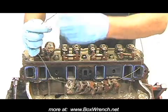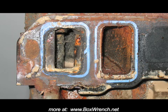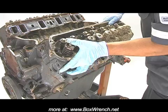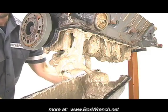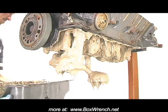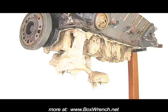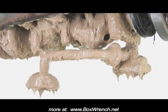As we're going through all these pieces pulling things off, we're looking at gaskets, looking for cracks, looking for easy-to-spot damage — everything's fine. There are no signs of gaskets leaking water through the water jacket into the oil areas of the engine. We just keep digging deeper. When we pull the oil pan off, the whole oil pickup tube was covered — every space inside the crankcase — and the water just kept feeding in there. The crank is whipping it all up and mixing it with the oil, and it just frosted and turned into this cappuccino milkshake.